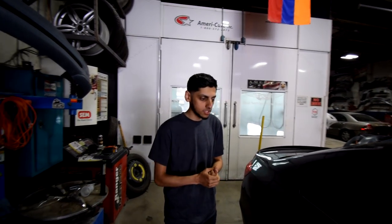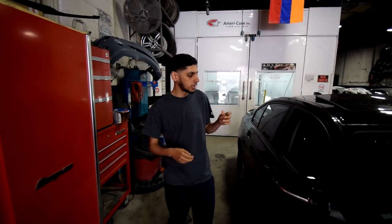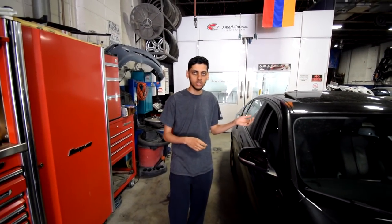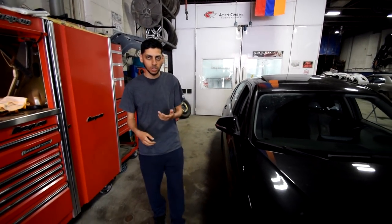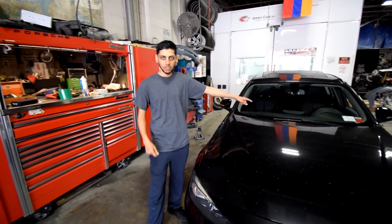A lot of you ask me on Instagram or Snapchat whenever I make a video, from when I used to drive the F30 a lot, why is your brake light on? It was because I never installed my rear brake pad wear sensor. Actually, I did, but I got an aftermarket one. So this time I made sure to get an OEM one, so that should turn off the brake light in my dashboard.